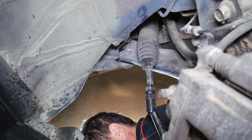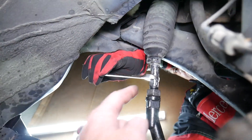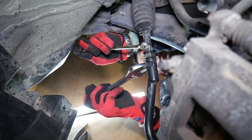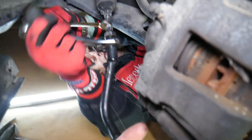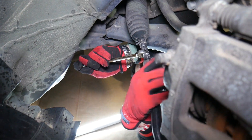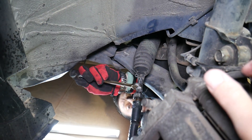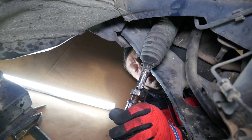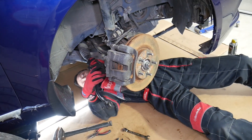You can see the smoke still from the rust. You need a 15-millimeter socket — in our case a wrench — and a big wrench, and start getting the tie rod loose. In some cases it may be so tight you have a really hard time. If that's the case, install the tie rod back on the hub and use two or three wrenches at the same time, because one will just slip. On another car we even used a pipe wrench because it was so tight. You can see the rust inside — we sprayed penetrating spray earlier and it ate through all that, so everything is coming loose.